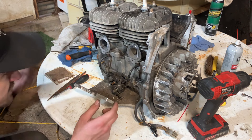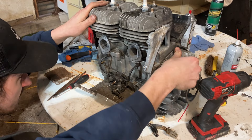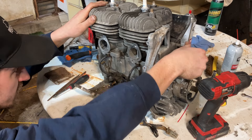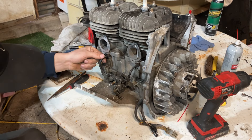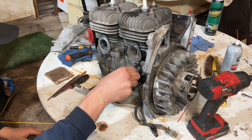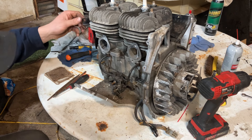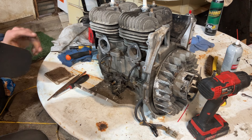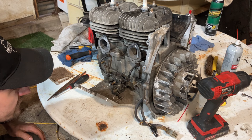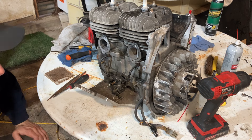So we've got our intakes exposed. This thing looks fresh, guys — I'll show you when we get it apart but it looks really good. We'll take our oil lines off next off the oil pump — we'll replace these, they're getting very, very hard. We'll work on getting the exhaust studs or nuts off the studs next, and hopefully we can get that manifold off and get that other fan shroud piece off. Then we can work on the flywheel portion and the top end and we're home free.